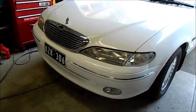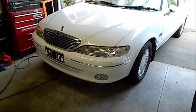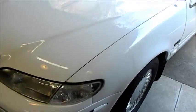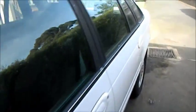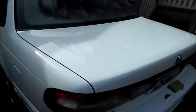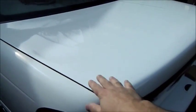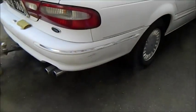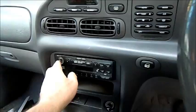The Fairlane is looking beautiful now. The front bumper is all finished. There's a tiny bit of growling from the power steering pump — there's still air in the system that's taking a long time to bleed out. Still haven't washed it yet. The boot had a horrible mark and I've rubbed it out and ended up blending the paint, but if you buff after blending it leaves a mark, so I've rubbed the whole boot back and clear-coated it — it still needs to be colour sanded and buffed out.